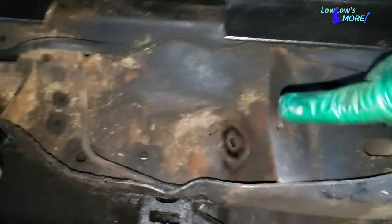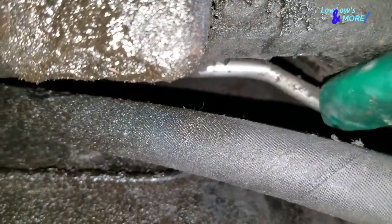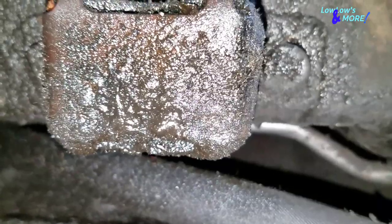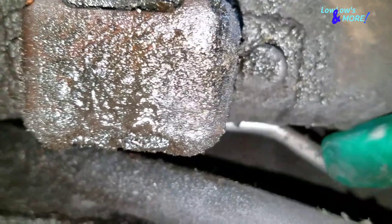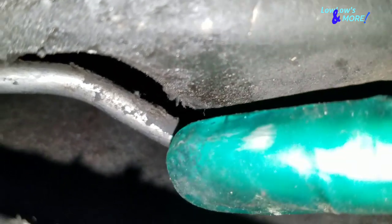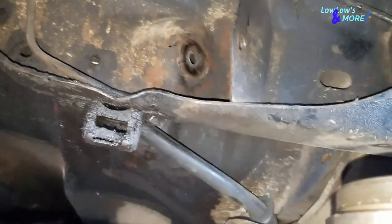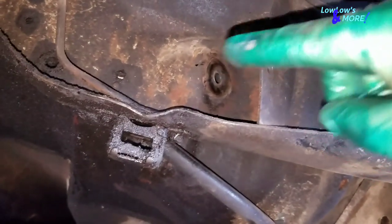When you're taking off the top bolt, there's another fuel line in the way. See this fuel line right here — it's blocking access to the nut that's connected to the bolt. There's a small gap from the fuel line to the frame, and you're supposed to stick an end wrench in there. Make sure you get it in there because it won't want to grab hold. You'll need to pry the fuel line away just a little bit — not too much, you don't want to break it — and then the bolt slides right out.